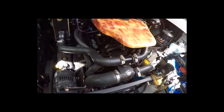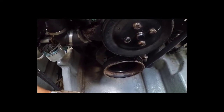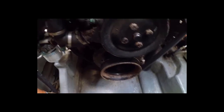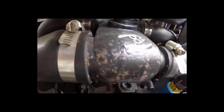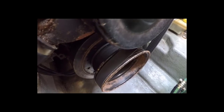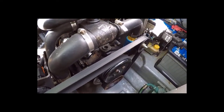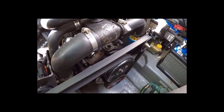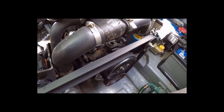What indications do you get that it's time to replace the water pump? You see the rust on the pulley that rests on the harmonic balancer, and a little rust on the water pump itself. That's coming from water leaking out past the front seal of the water pump and getting slung around by the circular motion of the pulleys and belt. On the starboard engine, I let it go too long, and what started as a small leak turned into a streaming water that filled up the bilge pretty quickly. It wasn't good, so this time we're going to get ahead of it.